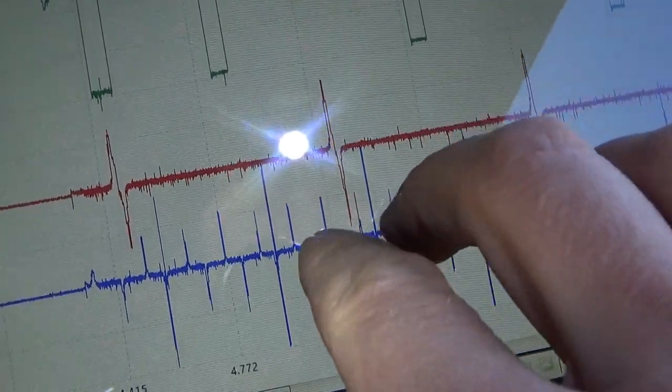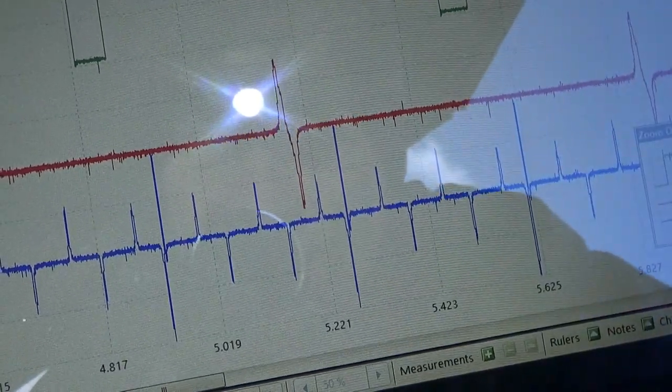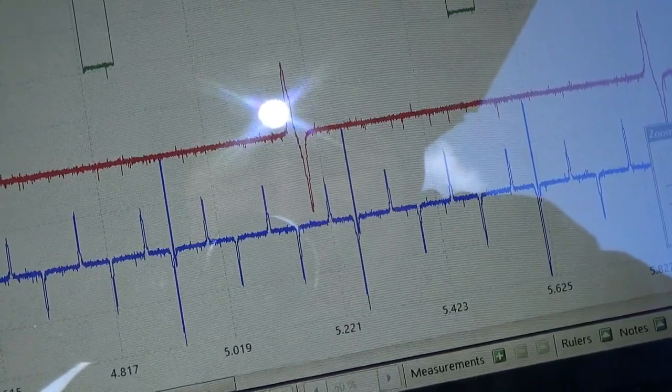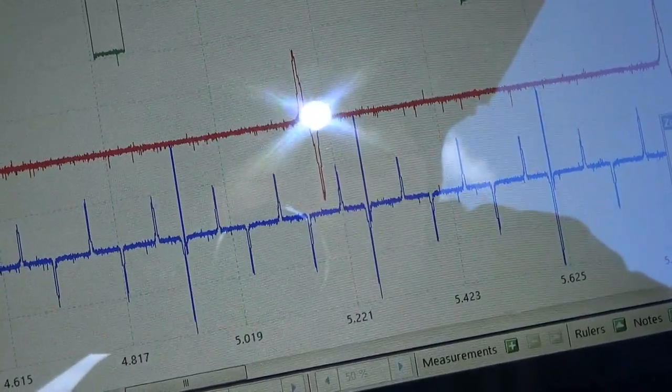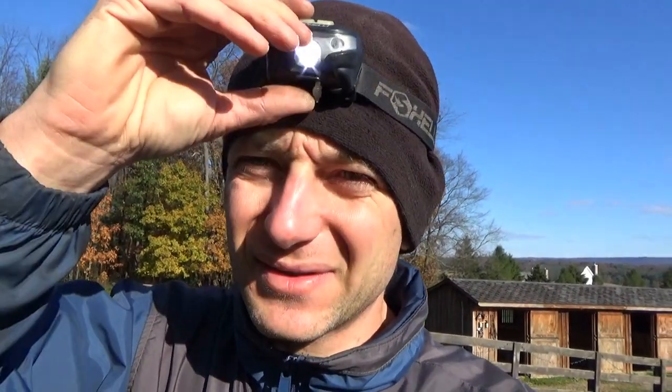Apparently the computer is fussing about this — it doesn't like the actual signal. The signal is there but it's some weird stuff. I've got the waveform saved. If we can find a known good waveform that would be great. The owner has a daily driver — another one of these with the same engine — so it would be really neat to compare a known good crank pattern.